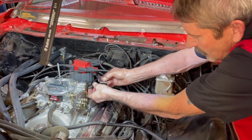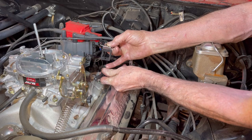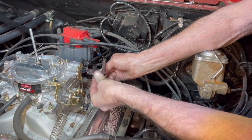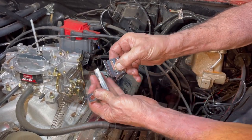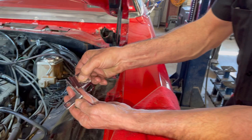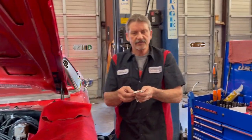When you have this on there, I pull the cable adjuster all the way to the end right here, and then I pull this cable back. Then I get my piece adjusted just like this — I can kind of get my angle and everything where I'm going to be. Where we're going to put this is about a quarter of an inch past this, just like that. We're going to TIG weld that back on there and now your bracket is going to look just like this.